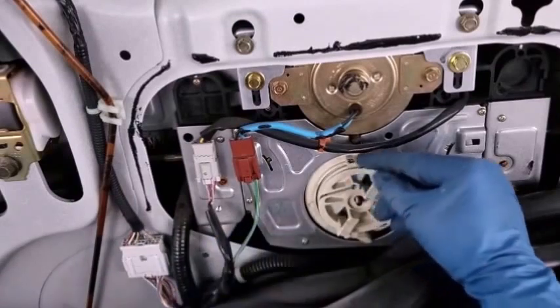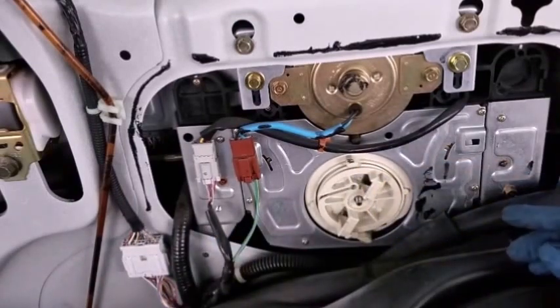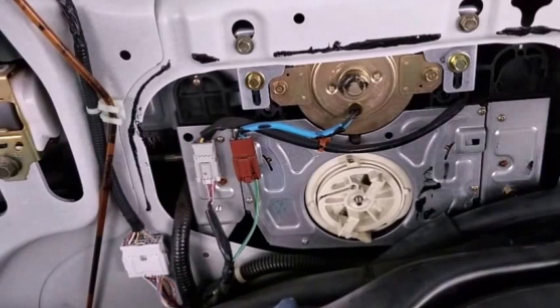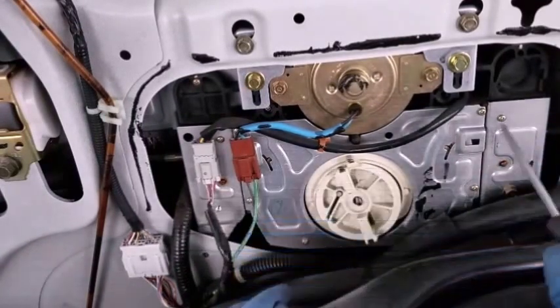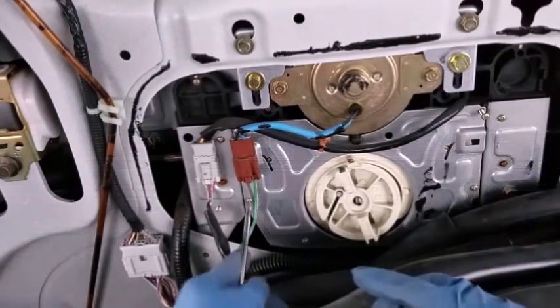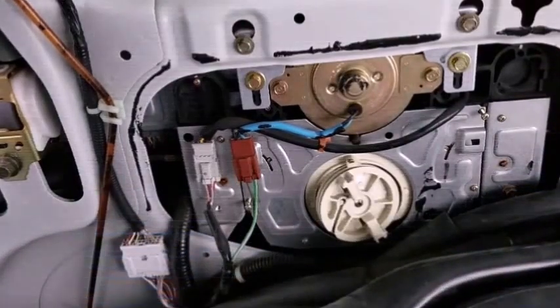This one needs to release the tension on the sliding door cable by removing the upper pulley, which is the smaller one. Once it's pulled out and the cable has some slack, then the star screwdriver takes off all these screws.